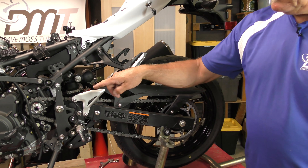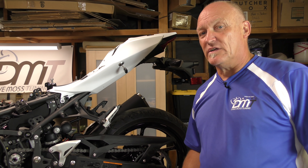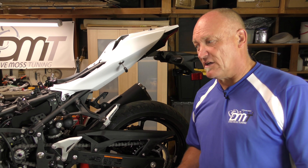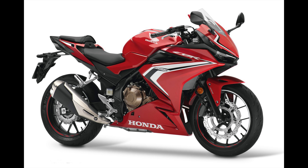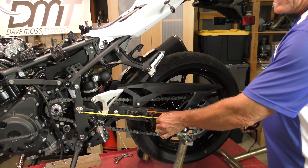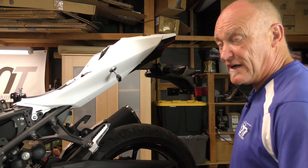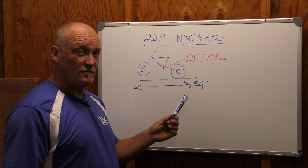This is technically more important than the entire wheelbase. The longer the bike, the more stable it is. The shorter the bike, the more nimble it is. So if you're curious and you've got a couple bikes in your stable, go measure a light ADV bike like a DRZ 400 or a Honda CBR 500 and look at your wheelbase, but also look at your swing arm length from center of the pivot to center of the axle. There are some very interesting facts about that.